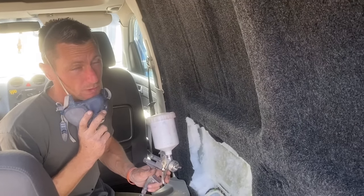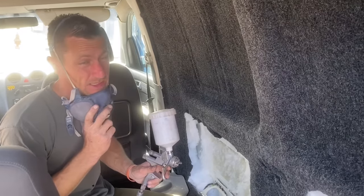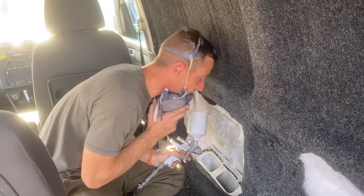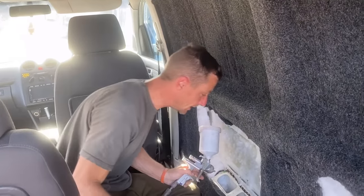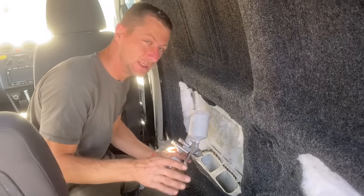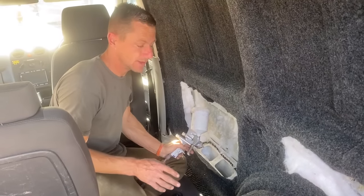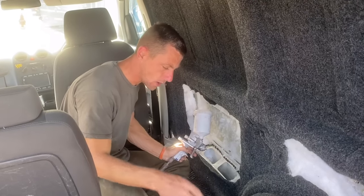Oh yeah. One thing I want to show, it is imperative. I know it's a strong word for this channel, but it is literally imperative that if you've done some welding, there's bare metal on the inside here. If I look down there, I can see the inside of what we've welded, and you need to coat it or it's gonna come back through fast.